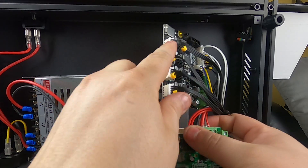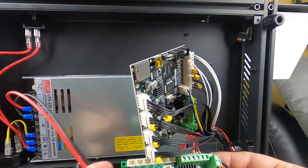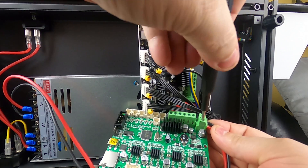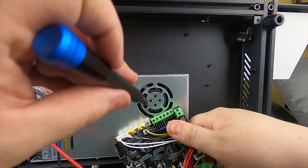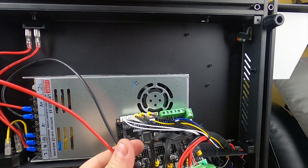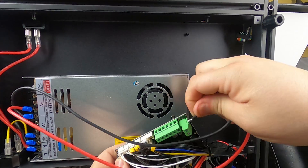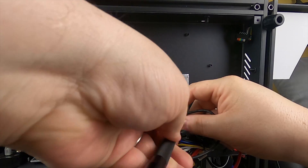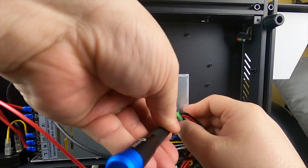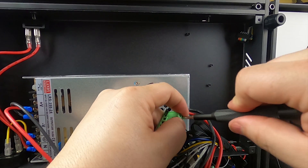This is the first time I've ever seen one with glue on the power wire. So we're going to swap the two single wires over first — that's the power supply in. Just going to loosen them up on the old one and pop them out. Loosen up the new one here. The bottom on that is positive — you can check the board, you can see right there positive negative. The black is the negative wire. Loosen it up a little bit more, hold them in there, and then snug them back down.